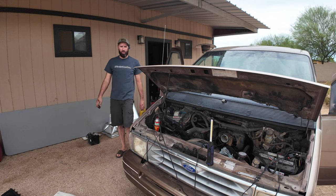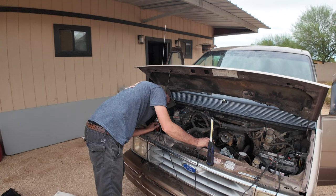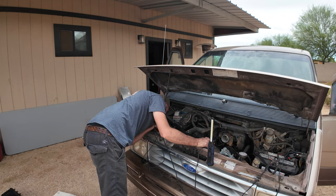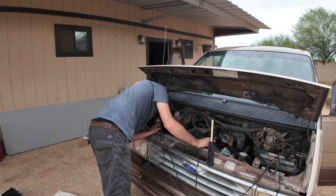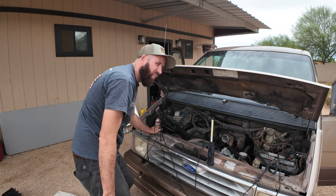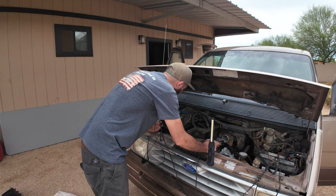Let's loosen up this distributor. Give it a little, maybe that'll help. All right, give it a little turn. Let's see what that gets us. Back the other way. Went a little further, let's tighten it down, see what we get.